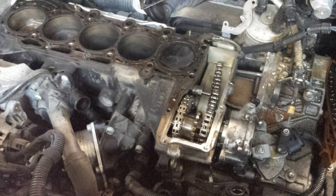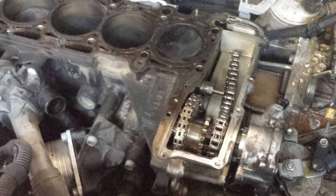Now, is this a DIY part? Well, this is going to be a big job. You're going to be taking the intake off, taking the exhaust off, and removing the cylinder head. And odds are, especially if the vehicle overheated, we're going to want to check the cylinder head and the block to make sure neither one are warped. If it's an aluminum cylinder head or an aluminum block, that becomes even more critical. For the average DIYer — the person who changes their own oil and replaces their air filter and maybe their brakes — this is probably not a DIY job for you. It may require special tools, it's a lot of work, and can be very messy. You're draining all the engine coolant and oil, so you'll end up with a lot of chemicals that need to be disposed of. On other makes and models a head gasket may not be that big a deal, but on a four-cylinder or really any Volkswagen overhead-cam engine, this is going to be a bigger job and not something the average DIYer really wants to tackle.